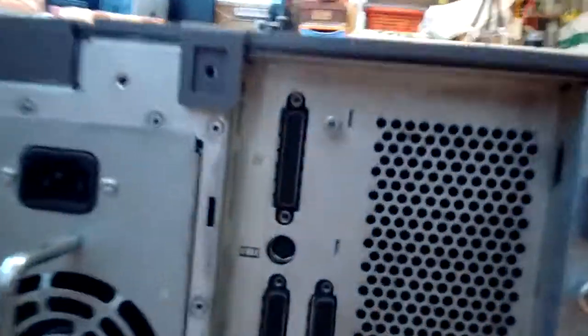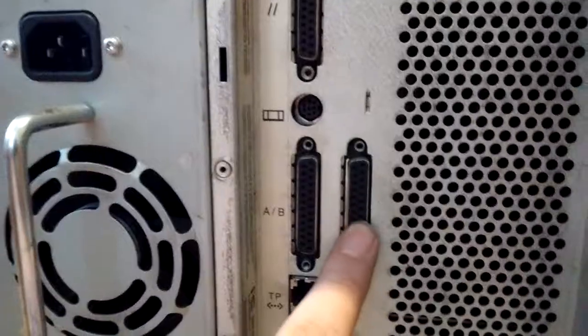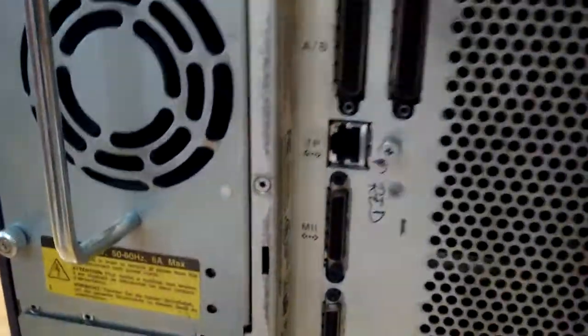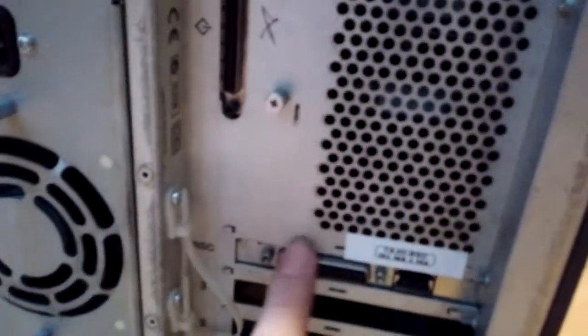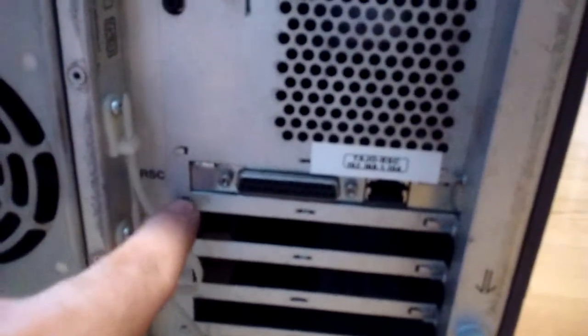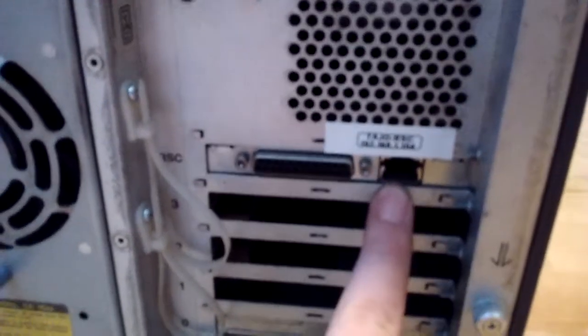Let's take a look at the ports in the back. We've got parallel, some keyboard and mouse, two serial ports, twisted pair Ethernet, AUI Ethernet — these two are shared, you can't use them both at the same time. We've got Ultra 2 SCSI, low voltage differential, single-ended. And then we've got the RSC — pretty much the SSP interfaces, which are a serial port and then Ethernet.